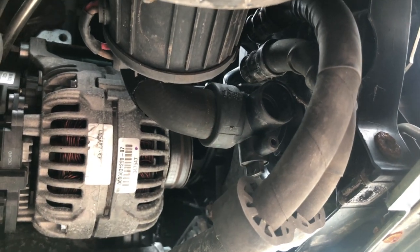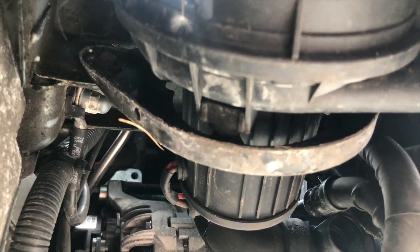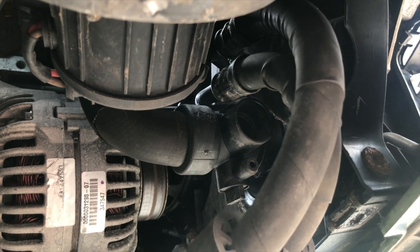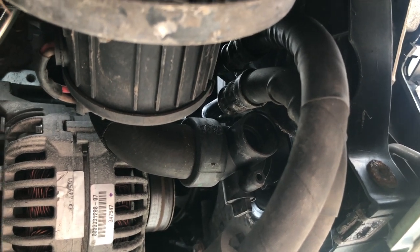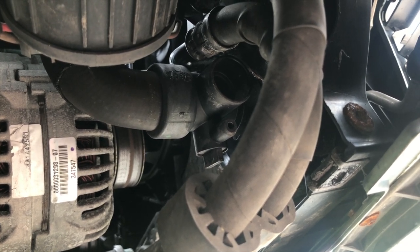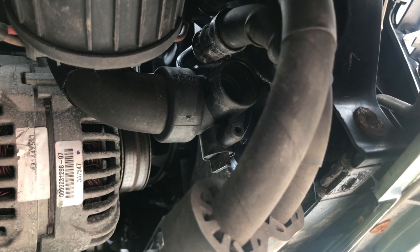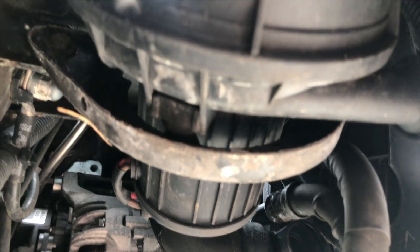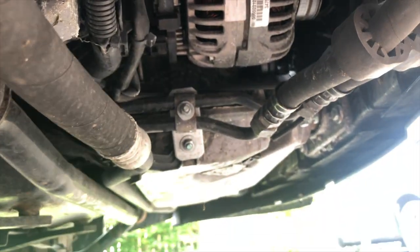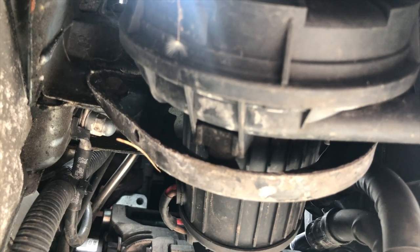I will have the antifreeze tested to make sure it's strong enough for winter. Some shops can do it — it's just a gauge and it'll tell you if your antifreeze is good. I know this antifreeze was changed five years ago when the timing belt was carried out. It's pink or red antifreeze, it lasts five years, so it could be changed. It's about £15–17 at Euro Car Parts — just drain it for 10 minutes, flush, fill, warm the car up and the job's done within the hour. You do have to take the under-tray off though, which requires jacking the car.